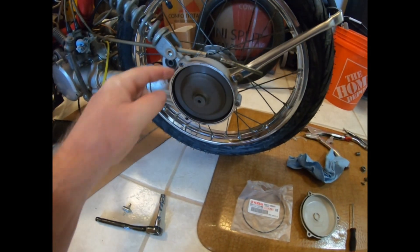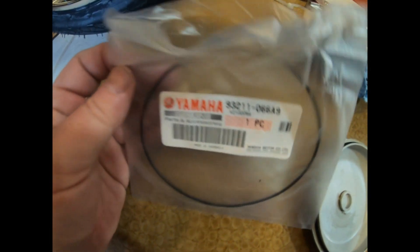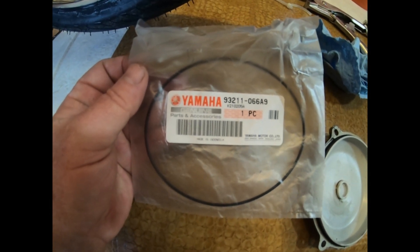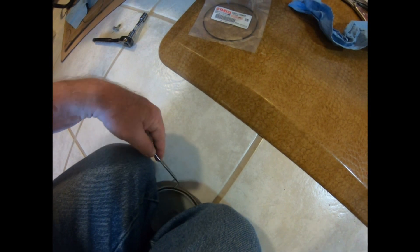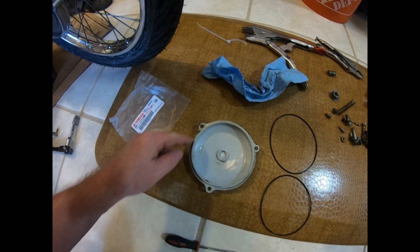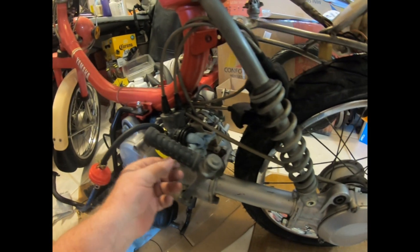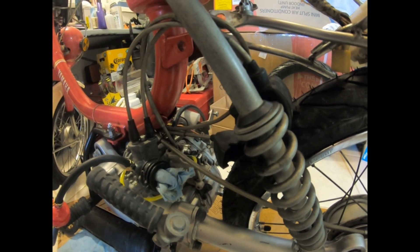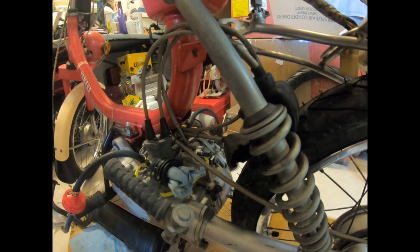I ordered a new seal for the driver assembly cover. Here's the part number — it was an eBay item so I can't really tell you who the seller was. It's very fragile and very thin, so be careful when handling this. There's the old one and here's the new one. I'm going to pause for a second and clean this up really good — I want both surfaces to be pretty much pristine. The line from the oil pump to the carb — I'm 100% positive on that oil pump — so I'll run some pre-mix on it first, but I did blow it out with PB Blaster and then some light oil through the bleed valve.